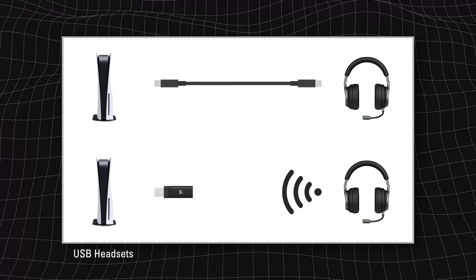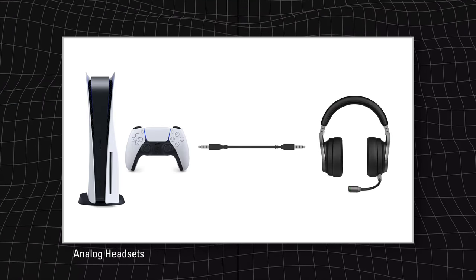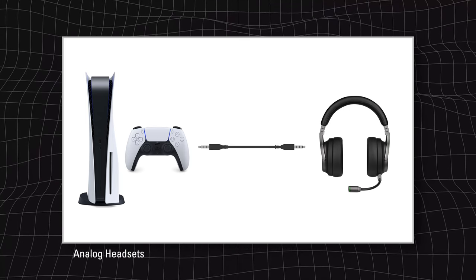The first question you need to ask when figuring out how to capture audio on the PS5 is what type of headset are you using? And I don't mean brand or model, I mean the connection type. There are three types of headset connections for PS5: there's USB, there's USB and optical, and then there's analog audio, which is a 3.5mm 4-pole connection, otherwise known as TRRS. I invite you to take advantage of our video chapters to jump to the type of headset connection that applies to you.